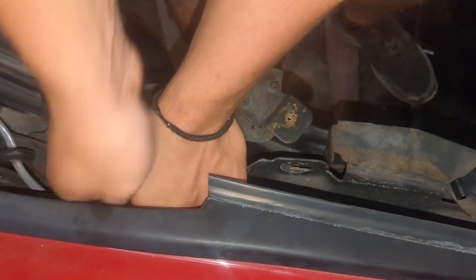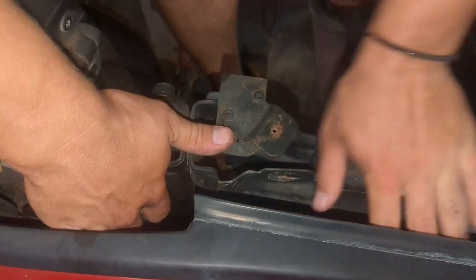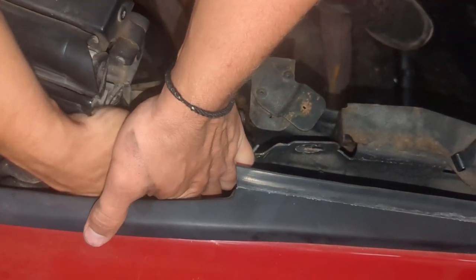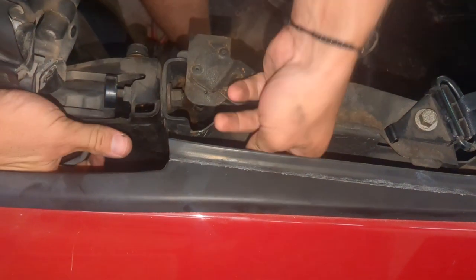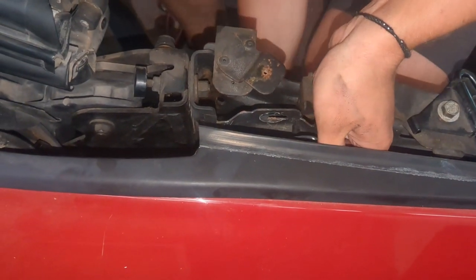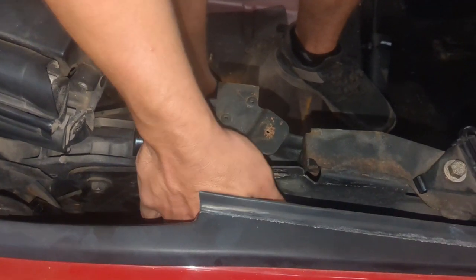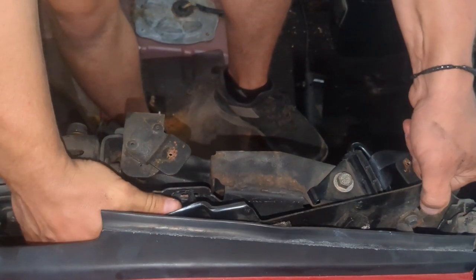Next, I pushed the bolts holding the motor through so that the window fell out the bottom of the tracks. Now I'm gonna extract the tracks from inside the body. Just push it through and sort of wiggle it around and lift it up, and it should come sliding right out. It's a little tricky, but keep finagling around in there and you'll get it. Almost. Don't forget that bottom one, poking through. Almost. And there you go.